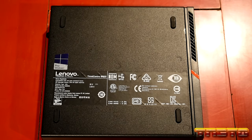You will note that this will also reset the date and time on the unit. So you have to go into BIOS and set that, especially before you go and install an OS, stuff like that. It's just good to have it somewhat accurate. But yeah, the old battery's been removed. It's that simple, guys. Okay, guys, next thing we're going to install is our M.2 SSD.